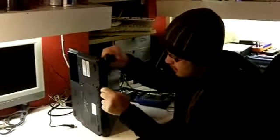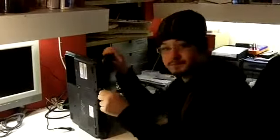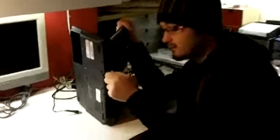I'm going to just hook it up there and see if it's loose. Come closer. If I get this much play, I'm pretty confident that it's a DC socket. Look how much play there is. It's very loose. So if it's playing like that, it's no longer making connection.